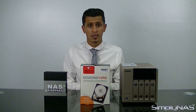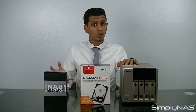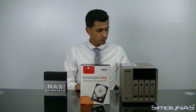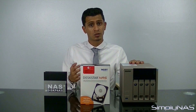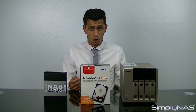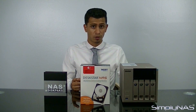There are four USB slots at the back. If this is your first NAS and you have data sitting on external hard drives, it's easy to back those up to this NAS. You can also use external hard drives later to back the NAS up for an extra layer of protection. There's one built-in power slot — no external PSU required. There's also an expansion slot at the back that allows you to install additional LAN cards, either a single-port or a two-port 1GB expansion card. Bonding the expansion slot ports is separate from the onboard ports; they must be bonded within their own group. This gives you either four IP addresses or two bonded pairs.